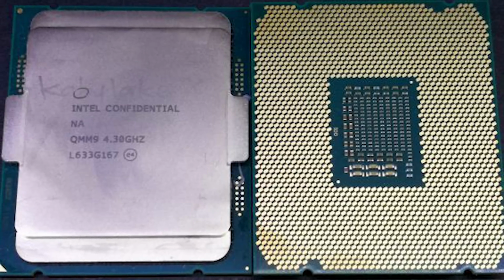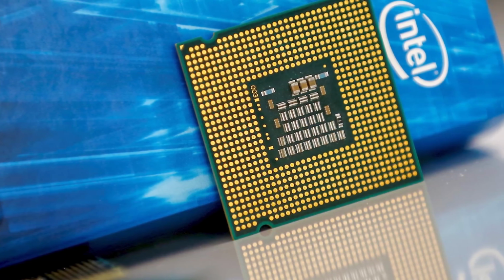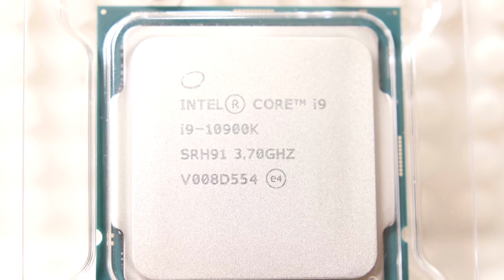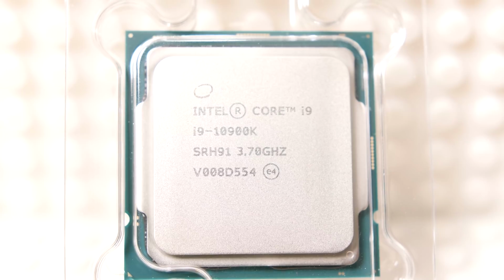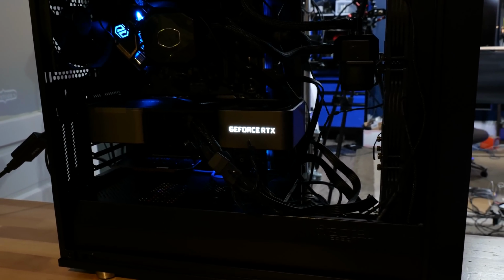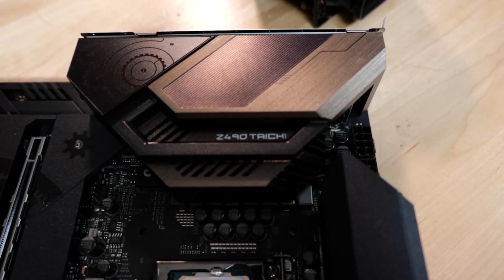It's really just designed for the 10th and 11th gen processors. And I know 11th gen's not here yet, at least at the time that I'm shooting this video. It's right around the corner, and this might be super handy for it because I never would have thought I could get 5.4 or 5.5 on my 10900K. And that's a retail chip, it's retail. It's better than my Intel also sent a sample, and I played around with the Intel sample. This is better than the sample, but this is also a really recent 10900K, so hey, maybe the process is improving. Now I gotta say, after tweaking and tuning and taking the reins off, this is much more insane than I really expected. Okay, so we're working with the Tai Chi, and you gotta kind of take the reins off the Tai Chi a little bit.